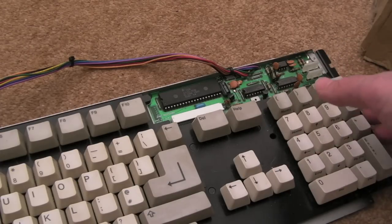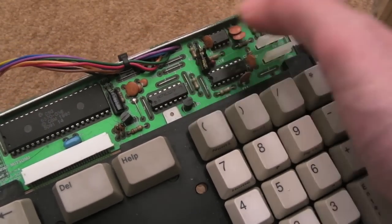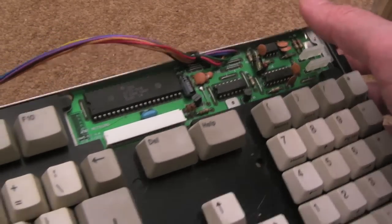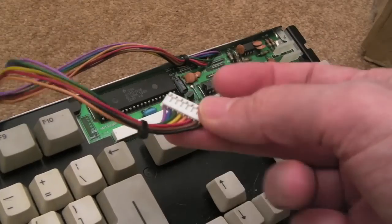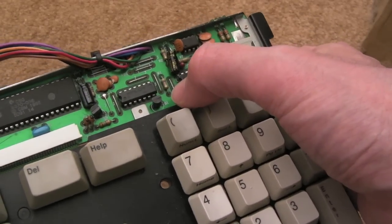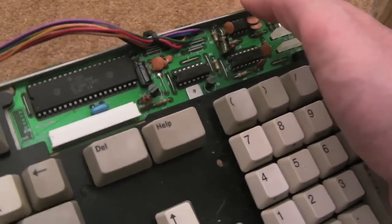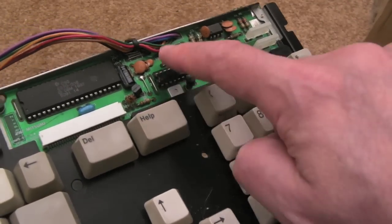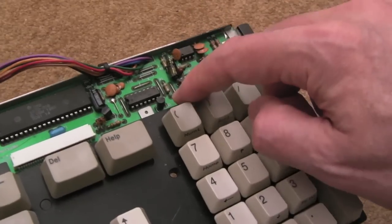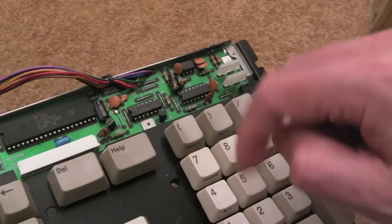There is a fifth connection — you could modify the keyboard and system to pass the reset across — but I want to try and keep the A2000s stock. One thing I've read: if you remove Q1, on some keyboards it reconfigures it so that the reset is done by doing something to the clock and data lines, just like the original A2000 keyboard does. I'm not sure I understand that, because looking at the schematics, Q1 is a multiple-input NOR that detects Ctrl-Amiga-Amiga and uses a transistor to drive the reset signal to the 555.